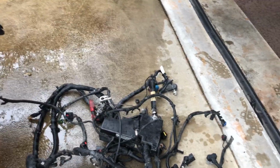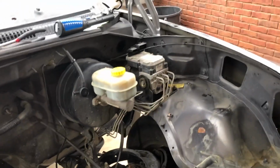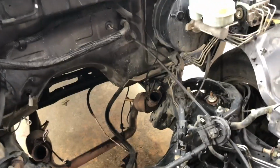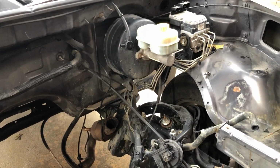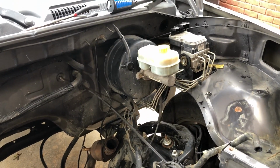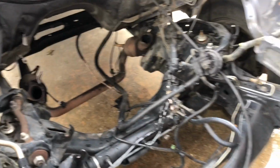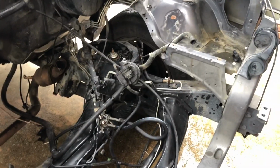I can get them in about 2 hours out of a Durango at the pull-aparts. Okay, but now you can see I've got a clean engine bay to go with. Now I can install my 03 Durango, or 03-04 Dakota wiring harness to get me the 4-plug next generation connector. So that's about all for today.